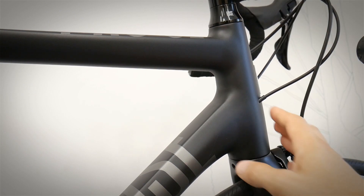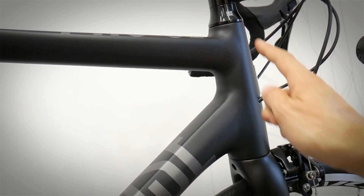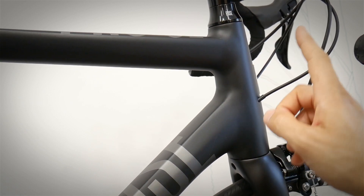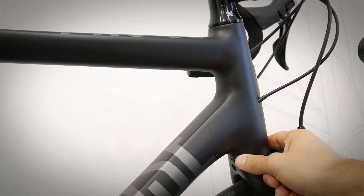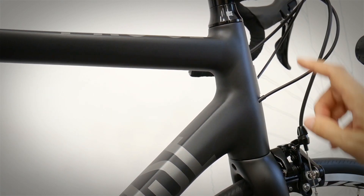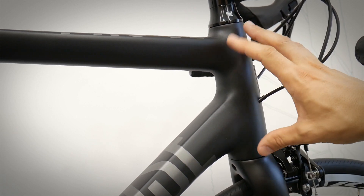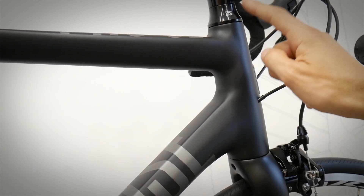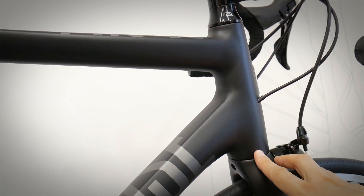You can see how much work the manufacturer has spent on your frame. One of the things to look at is the head tube. For $1,200 you want a tapered head tube — and not all bikes will feature it. That means the top bearing and the bottom bearing of your headset inside this tube should be different sizes — for example 1-1/8 inch by 1.5 inch. That also means your bike will maneuver better and be stiffer, so a tapered head tube should be there on bikes for about $1,200.